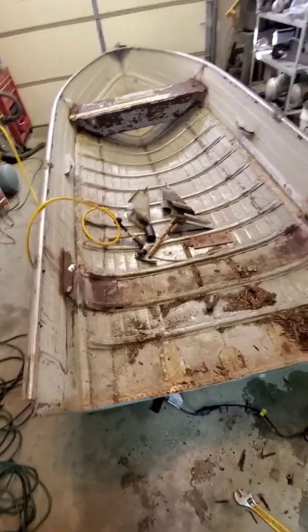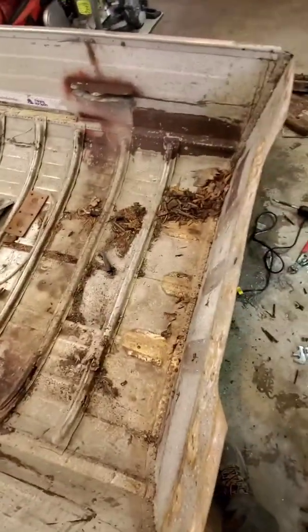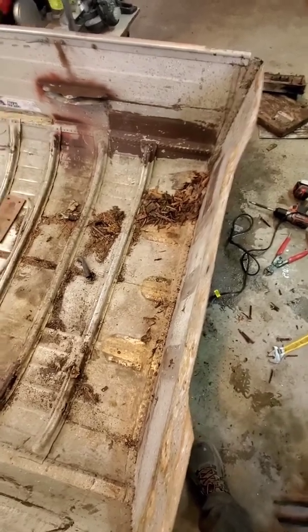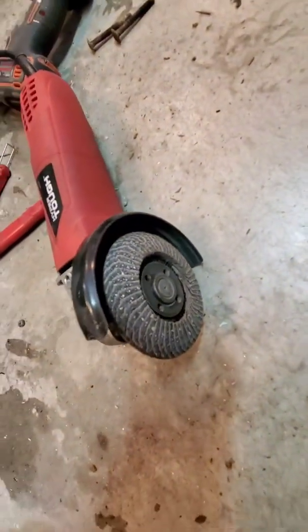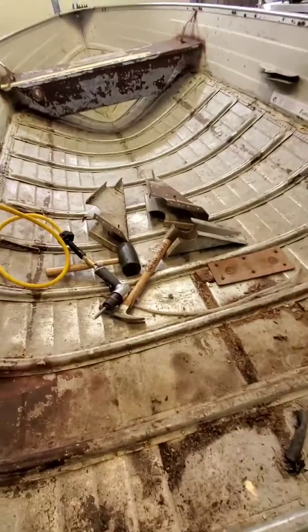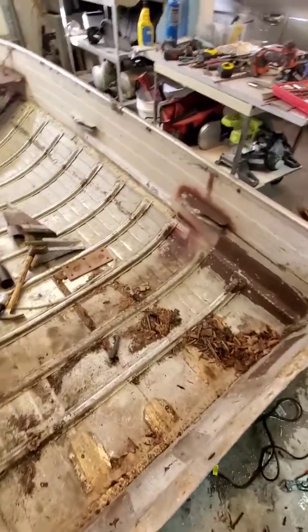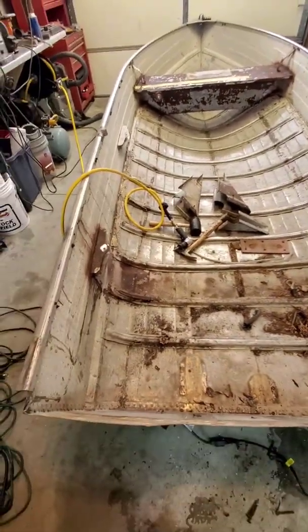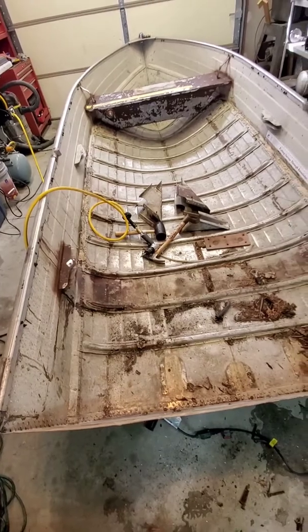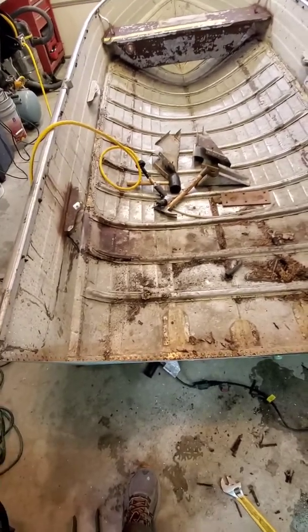I got the transom off, took out the seat, got the braces out - they're laying right over there. A simple way to do that was use a sanding disc on the grinder, then just sand off the top of the rivets and use this air gun tool - it's like 20 bucks at Walmart - and that'll help you push those rivets through the braces so you can get them out. I know it's not a super great quality video, but I learned a ton watching everybody else's videos, so I figured I'd share the experiences and tricks.